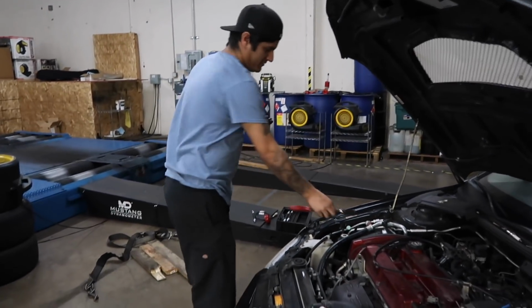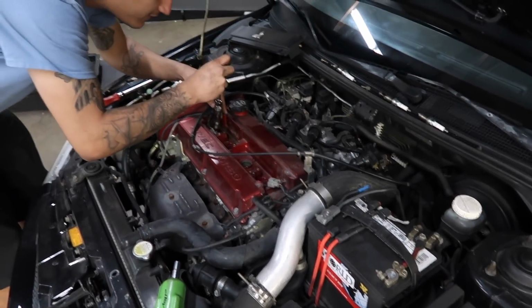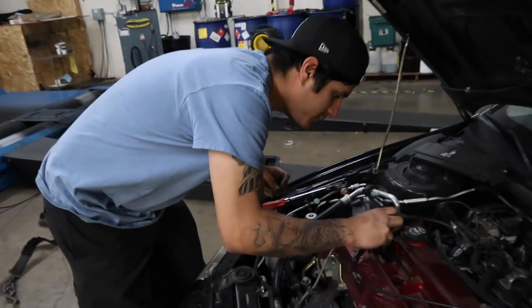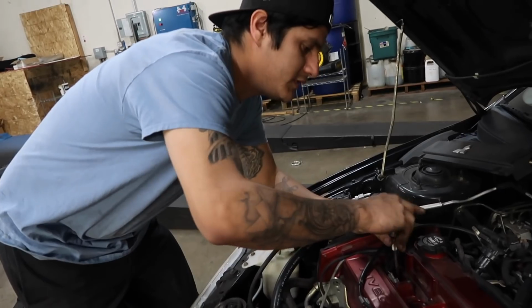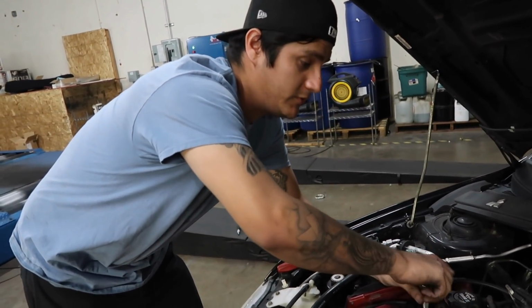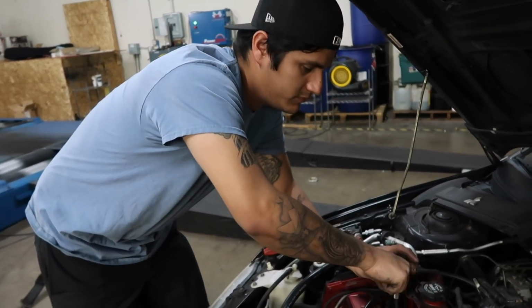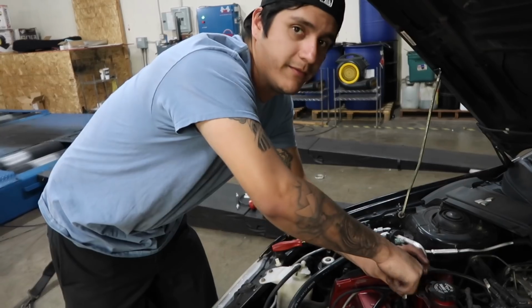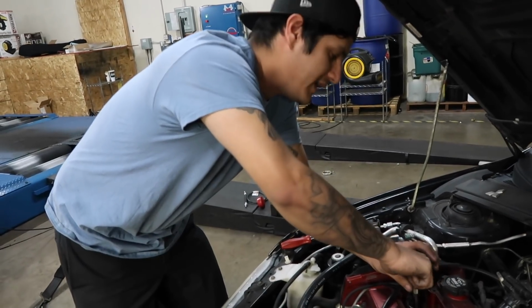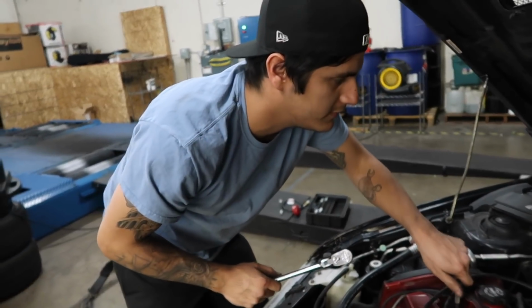Hey man, the motor's healthy. With 155 for all the cylinders, according to the Mitsu handbook, what was it, David? For Evo 8s and 9s, Mitsubishi considers a rebuild at 95. That's when absolutely you have to get a rebuild. In the performance world, you probably wouldn't wait to 95. You'll wait till like 120, 130. Yeah, I'd say 120, 130 is pretty low. Definitely get it rebuilt.